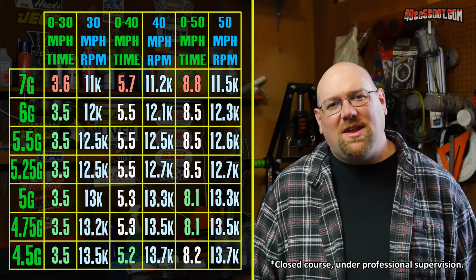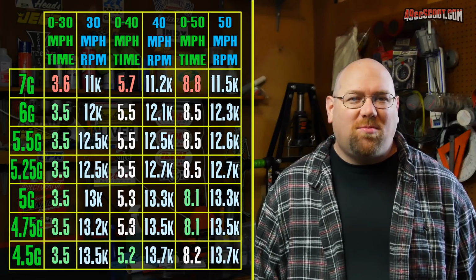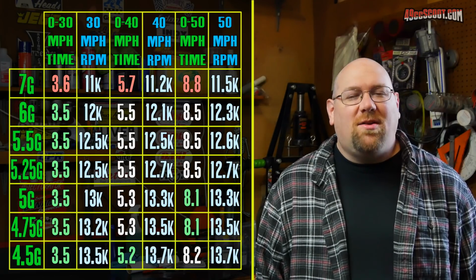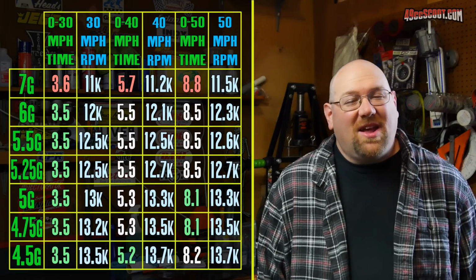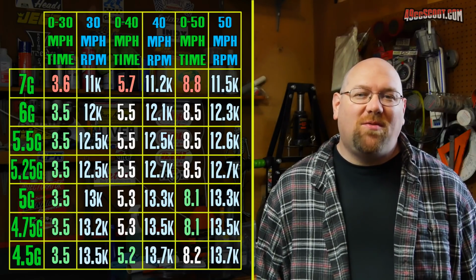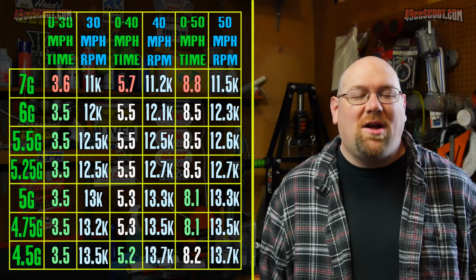And I'm assuming most of the time that I will be doing any sort of taking off on the street, I won't be doing it back to back as I did in these tests, because for these tests I literally ran 0 to 50, braked, turned around, and then ran 0 to 50 and repeated that until I had 4 passes done, which is not something you would normally do when you're just riding around. So for that reason, I decided to stick with the 4.75 gram sliders for what I'll actually ride around with.